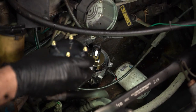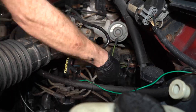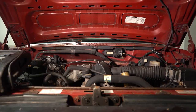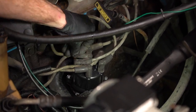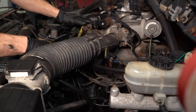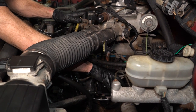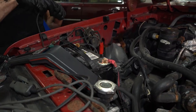You want to make sure you leave it just loose enough that you can carefully spin that distributor base. Next, continue on to installing your distributor cap. Replace or swap out the wires one at a time, being sure that each wire leads directly to the proper cylinder spark plug. At that point, continue on to reattaching the battery. Try starting the vehicle. If it starts, let it run until it gets up to normal operating temperature and then prepare to time the engine. If it doesn't start or run, make sure you double check your wires and the firing order. Assuming that looks good, you should try slowly spinning the base one way or the other while attempting to start the vehicle. The base might be misaligned to the point that your timing might be way off, in which case your engine might not start or run right. Once it's running and up to normal operating temperature, continue on by using a vacuum gauge or your timing light to properly time the engine.